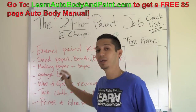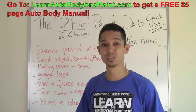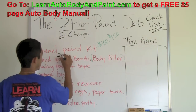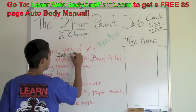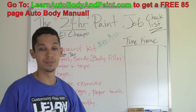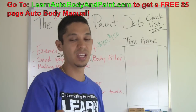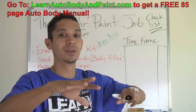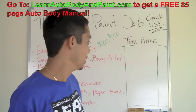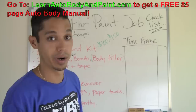I recommend painting over at least 280 grit or 240 grit with enamel. Enamel is thick and you don't have to go down to 400 grit like base coat clear coat. A 320 grit would be great to paint over. If you have peeling areas — clear peeling off, fading on the tops of roofs or hoods — make sure you DA and sand them all out, smoothing and feathering everything out. Put a light coat of primer on top of that, then hit it with a quick water sand or DA with 320. Make sure it's dry, tack it all off, wax and grease, tack it all off and you're ready for spraying.